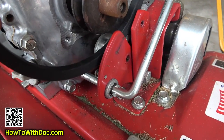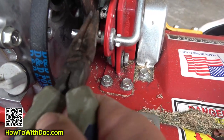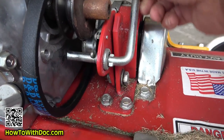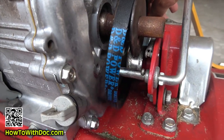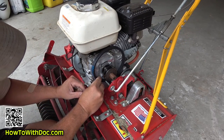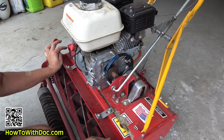Then you'll have enough room to actually get this out, so I just put it back in like that. Then we're gonna reattach that spring. To get this little spring back onto this pin you're gonna need a pair of needle nose pliers — grab the spring, pull it, and put it back on this pin right here. That gives your handle tension. Then all we're gonna do is rework this around this thing here. When you're putting your belt back on, you just got to remember that this release bar goes outside of this, slides back on — easier said than done.